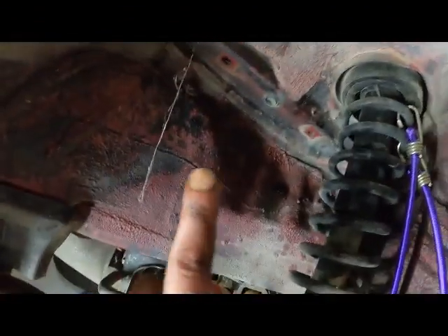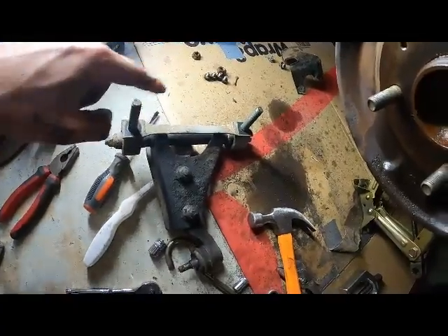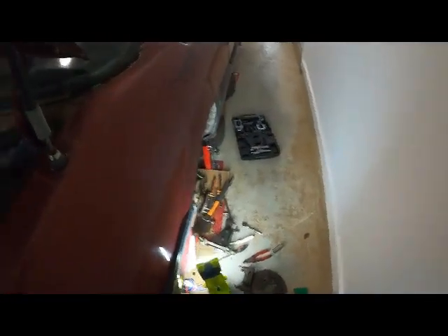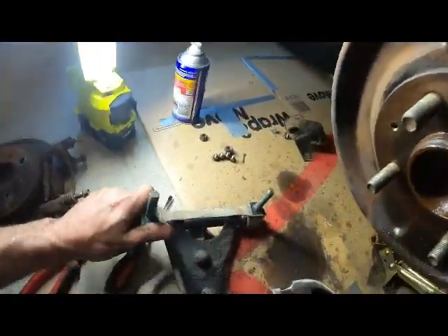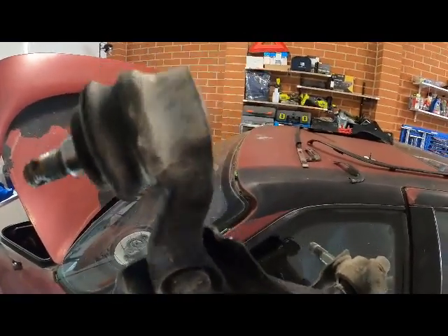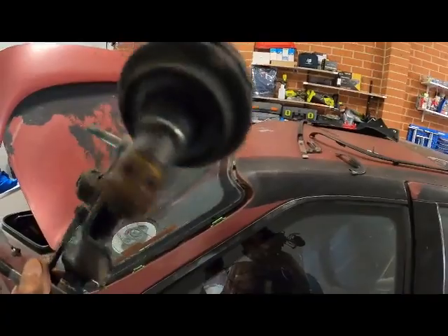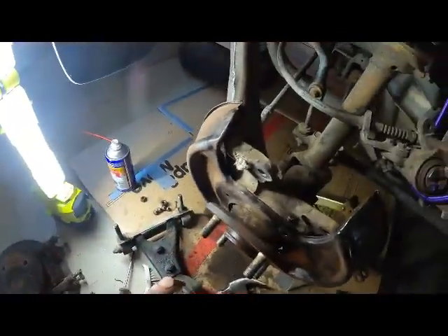Just like that — upper control arm, no more, there it is. Remember the couple of bolts in the trunk that need loosening? There you go — last one, size 17. Once you get them out, a couple of taps and it folds down because we removed the ball joint from over here. All this drama just to replace this bushing here and this bushing here. The ball joint looks in good nick but the rubber is dry — still not bad. I'm thinking this one needs to be cleaned up and replaced.